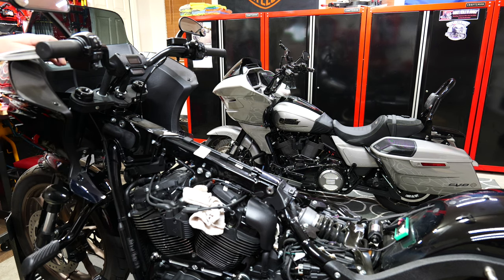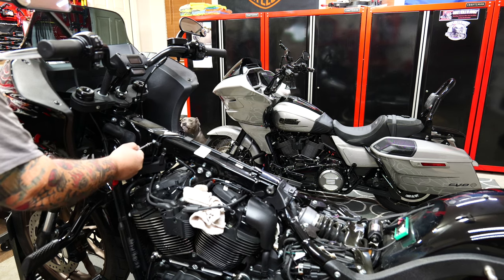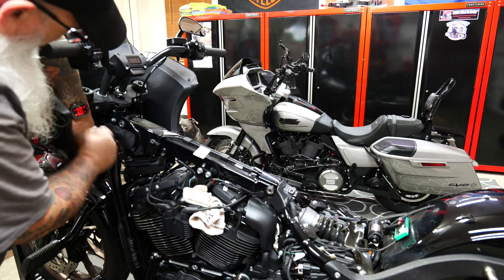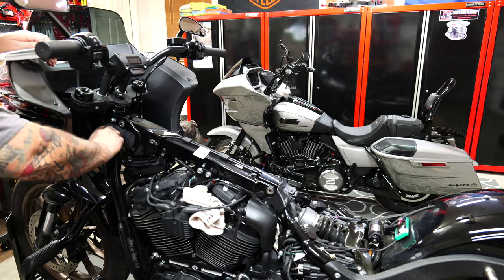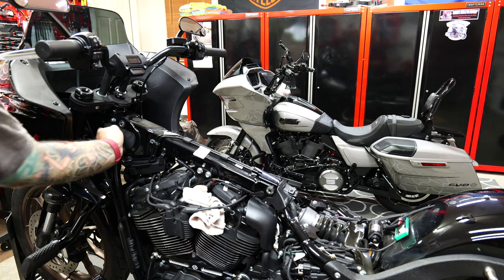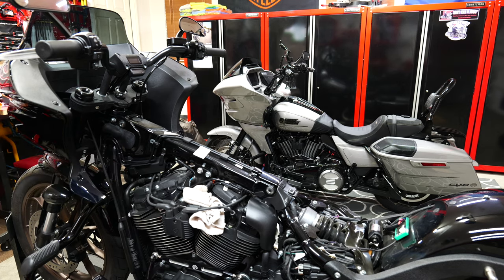Now we've got a lot more room to work here. The boot that we have to get to is right here. All the wires connect up underneath this. I'm probably going to take these lines loose — there's a bolt up here in the front and one here — just so they come out and it's not pushing on this boot, making it a lot easier to get out. This is a T27 so we're just going to take these out. Now that frees this up and these wires are nice and loose, so this boot will come out nicely.